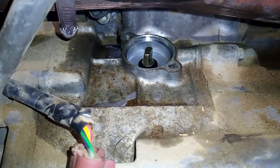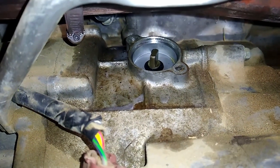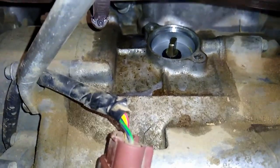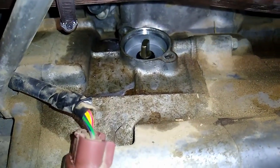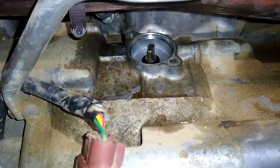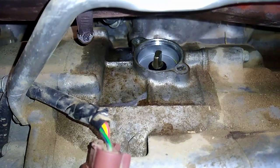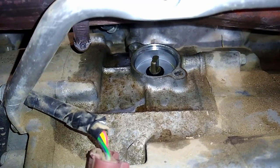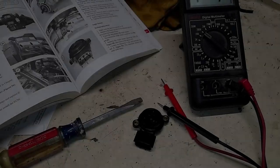Using a regular angled 4-millimeter Allen wrench, you can get those little bolts out. They're not too long — about a half inch. You can get those out without taking out the exhaust. It's just a little more time-consuming, but probably no more work than removing the exhaust and replacing gaskets. Four-millimeter Allen wrench will get that out — it's just slow going, but you can do it.